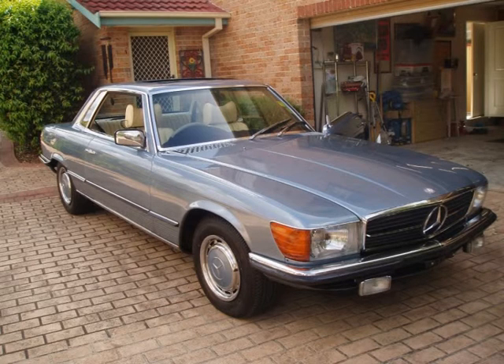I'm not counting the insurance or registration fee. All up, by the time I have the gas air conditioner and other things done, the total cost of this car would be about seven thousand in repairs, making twelve thousand dollars all up. The air conditioner gassed successfully. I have a slight problem with the cruise control — it's probably the module behind the speedometer, which I'll do one day. The brakes pulling to the left was the master cylinder; I changed that. And the steering box just needed pulling up. So that's the end of the story for this car.